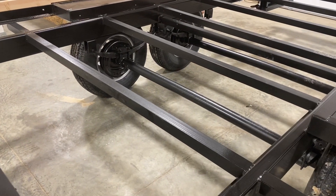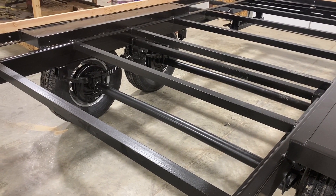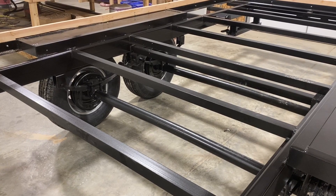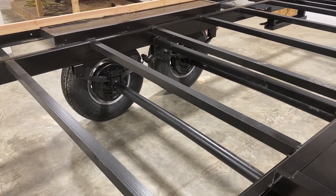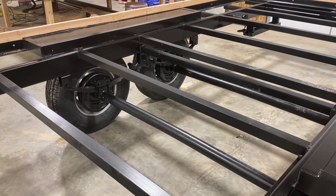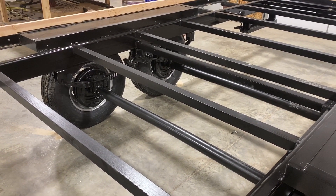This one has the seven-leaf spring package with the 6,000-pound axles. We offer a variety of different suspension packages as well as layouts. We do a lot of wagon-style frames with a tie rod setup or a fifth wheel turntable plate — it all depends on how you're using the camp. We've found that the majority of camps we build go with the leaf spring with the solid axle, just for the fact that parts are readily available. If you ever run into any issues, you can usually go to any of your trailer suppliers and get the parts.